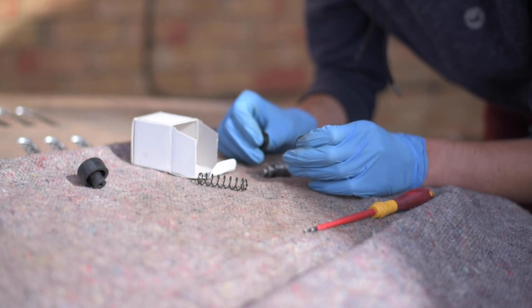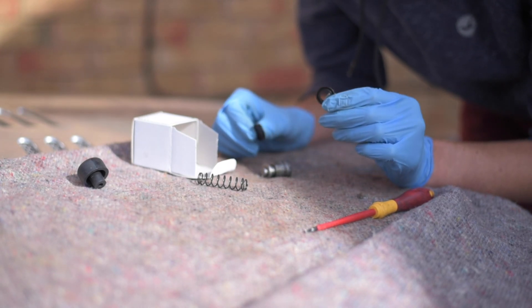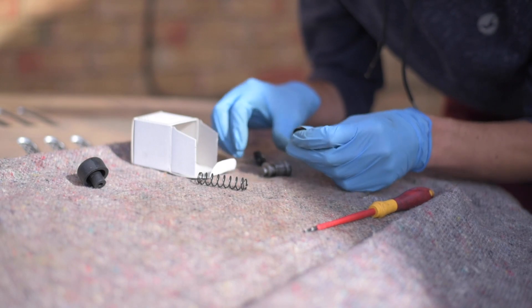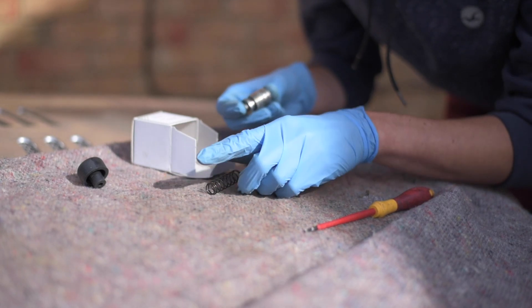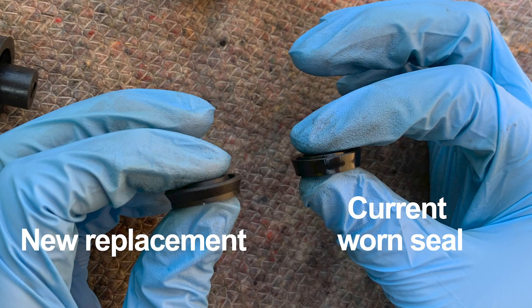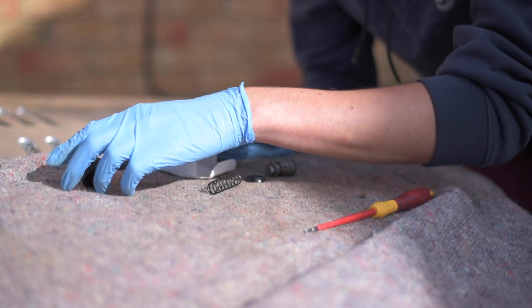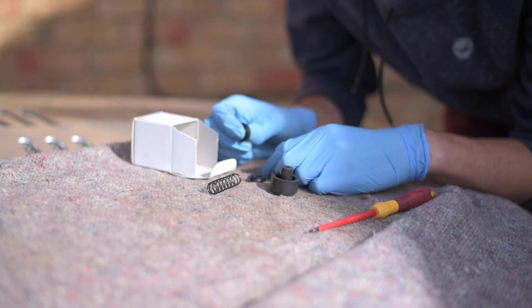I've now removed the piston from the slave cylinder and the culprit for why I cannot change gear is just this very small seal. It's a little rubber seal — it comes off of here and the spring goes into the cylinder itself. The seal is just slightly worn, and that is simply the difference. What I'm going to do now is put on this new seal, and I've also got a new dust cover, then we'll fit it back together, give it a test, and hopefully that will be job done.